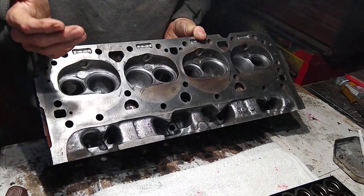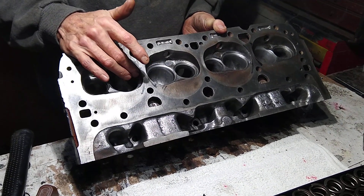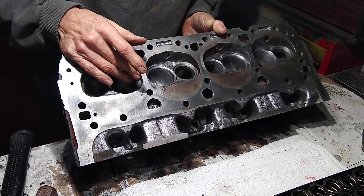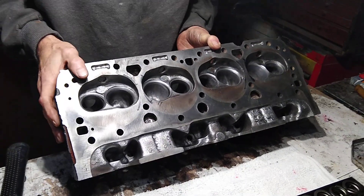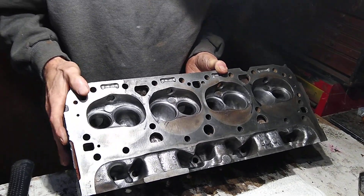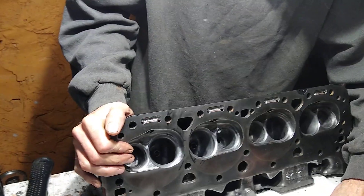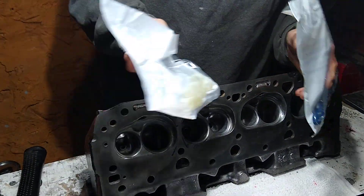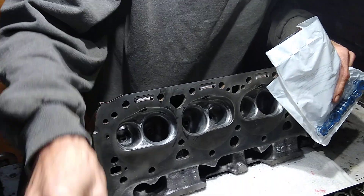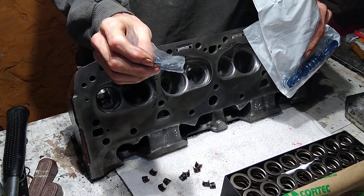You've got to really do the whole job. These are 194 valves, so they weren't shrouded really bad, but they were shrouded and they need to be cleaned up. What's the point in doing all this other extensive work and not doing the unshrouding? So that's where I am with these. We've got a box of brand new springs, all the parts have been cleaned. We've got new seals — I'm going to put positive seals on the intake, umbrellas on the exhaust, and I'm also going to put my stem seals up at the top with the keepers just because they can.